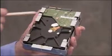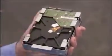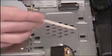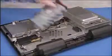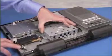The hard drive cage has four tabs on the bottom that fit into four slots inside the PC. To replace the hard drive into the PC, place the tabs on the cage near their slots, then slide the hard drive in until secure.